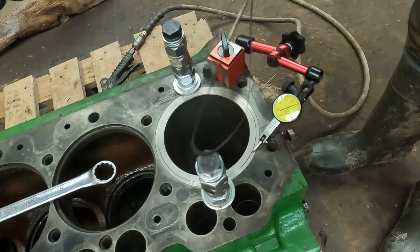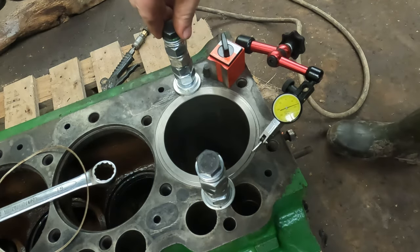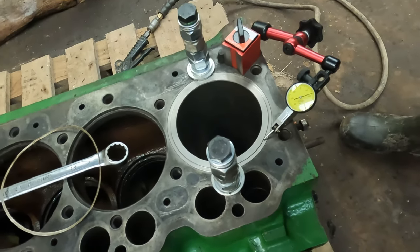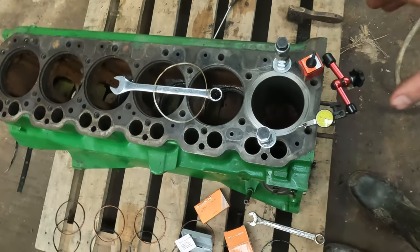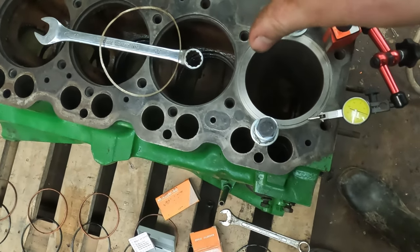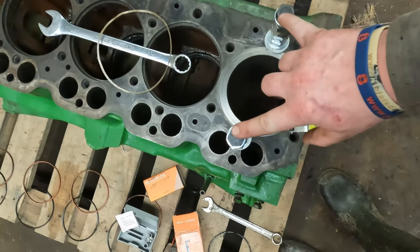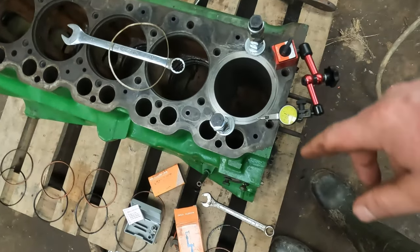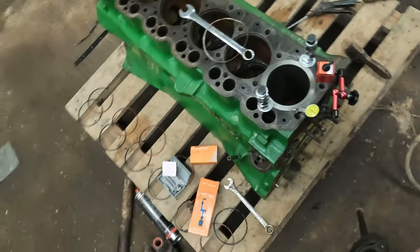Initially I put it in with the shim but it came out at about 20, so that's no good - it's got to be within that parameter. So what I'll do now is do the same for the other five, and then take them out, put the O-rings in, and press or knock them back in. What a lot of people do is just put the bolts back in like that just to hold it in so they don't pop back out again. I've showed you that one, I'll do the rest - it saves you looking at the same thing six times over.